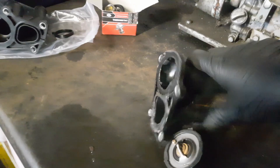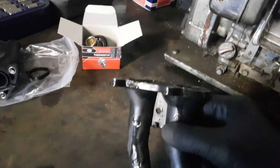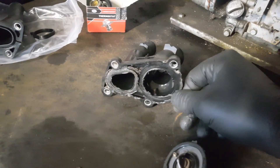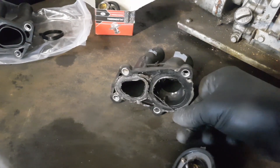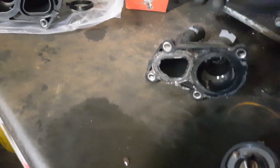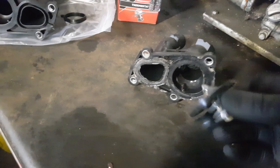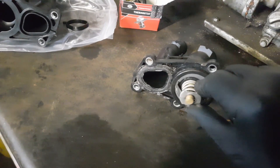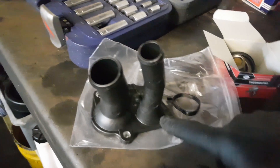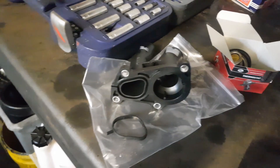There's my old thermostat and thermostat housing — it's that simple. As you can see, I've got one seal on the left, and on the right is where the thermostat sits. If you look down here you can see it's covered in silicon where somebody had a go at it. You shouldn't put any silicon on these — when there are new seals I put a bit of rubber grease on them, but that's it, no sealant at all. It'll actually make things worse. As you can see, there's no seal on the housing itself; the thermostat o-ring seals to the block directly. So here's my new housing.